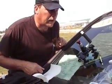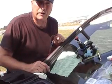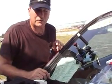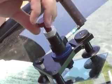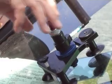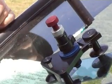Okay, this bullseye here has been under vacuum for about a minute now. And like I said, time is money, so you don't want to spend 30-40 minutes doing a simple break, because you're just wasting your time. All you do after your vacuum cycle, you just turn your injector down on your annihilator tool, down to the bottom of its travel. Turn your piston until you feel pressure, back it off half a turn, give it pressure again, let it fill right in. You can see it's filled right all the way right now.